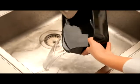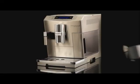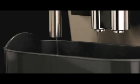Empty the container used to collect the descaler solution and replace it empty under the hot water spout. Press the button to start rinsing. Hot water flows out of the spout and the message Rinsing is displayed. When the water tank is completely empty, Rinsing Complete Confirm is displayed.